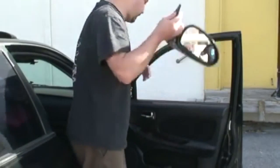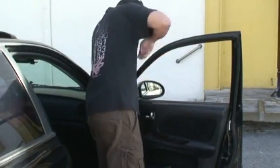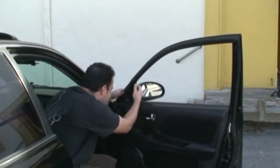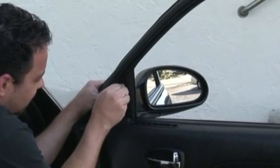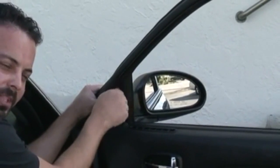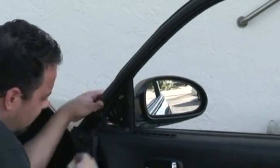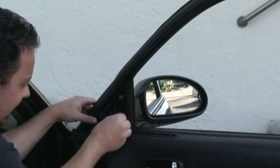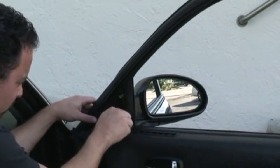And you simply put it in place. The bolts will pretty much center the mirror right where it is, but don't tighten the bolts till you have all 3 of them finger tight. That way you can adjust it slightly to make sure it's lined up properly.